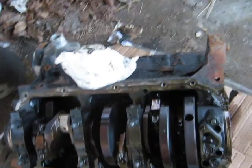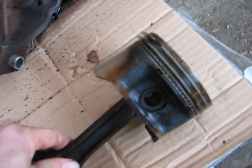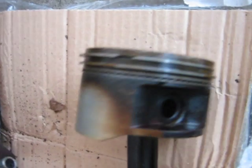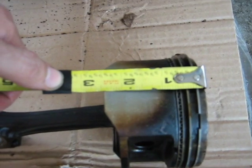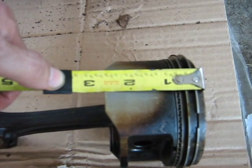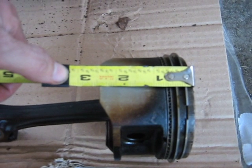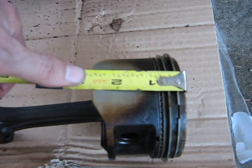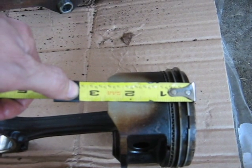Like I mentioned on another video, as I suspected, the V6 does use a slipper-type piston. It's not as bad as the 327, but here's the issue. Down to the black tape there, the engine's got about a 3¼-inch stroke to the piston and the side of the skirt's only about 2½ inches. So the piston's going to come down to where my thumb's sitting, and the inlet port is going to be open to the crankcase when the piston goes back up to the top.